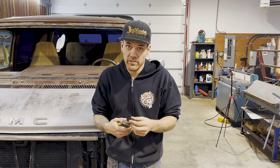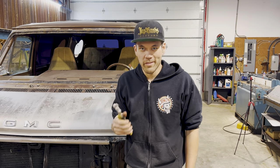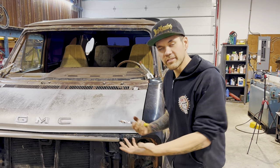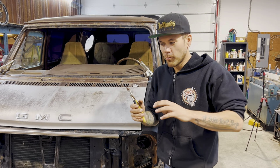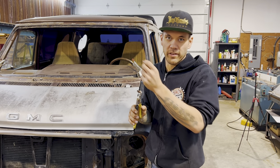That's kind of what they're designed for, is riveting aircraft. You put all these in place of where your rivets would be. They hold nice and tight. So I'm gonna put a few of these in, then I'll be able to take my clamps off, and we'll just keep working our way around, putting these in and drilling our hole.